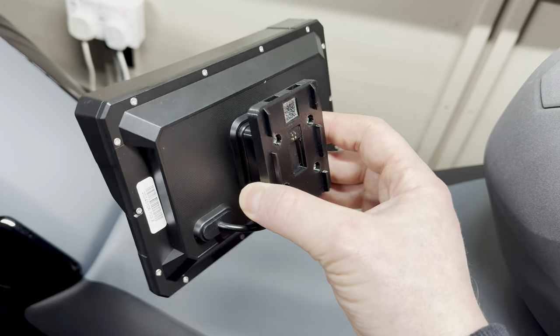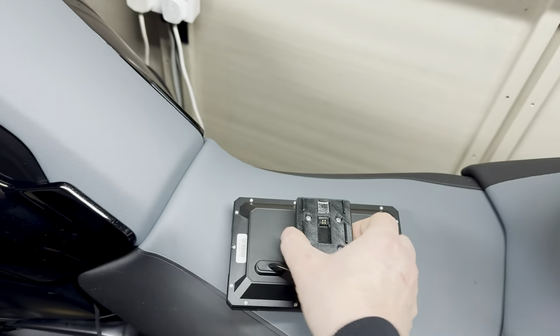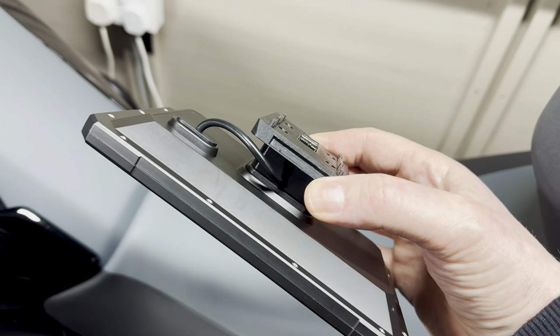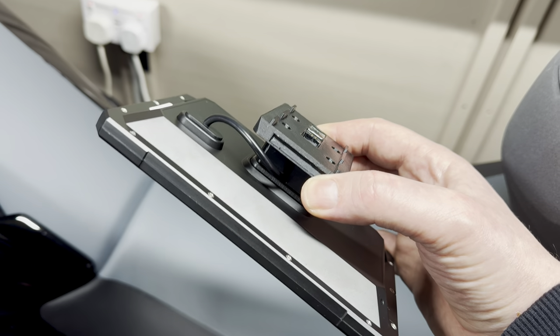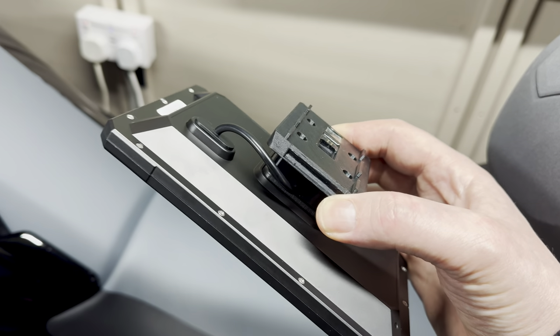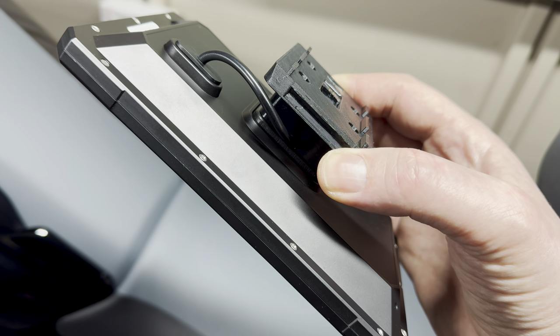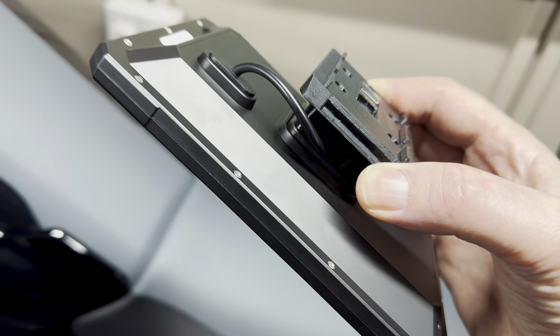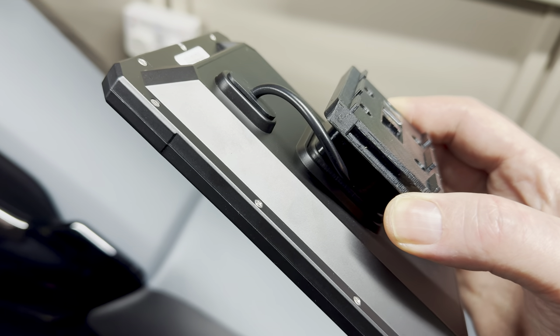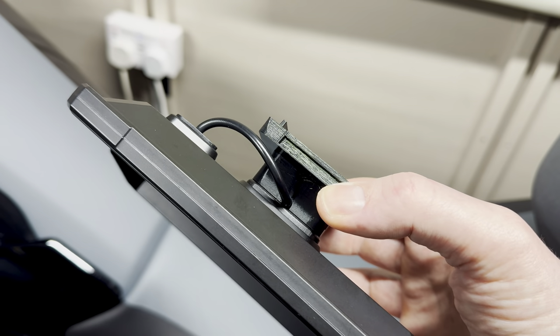He sent it out with full instructions and it arrived in just under a week from Spain to the UK. Very reasonably priced and as good quality as the 3D RAM mount I've got for my Garmin Zumo. As you can see, it basically bolts onto the back and picks up the power from the BMW cradle. There was a bit of wiring — I had to take the plunge and cut the wiring that came with the W702, which was a bit nerve-wracking, but it's only two wires. I could have run it straight to the battery, to a USB, or I've got the adapter to plug into the BMW CAN bus. But I took the plunge and it works brilliantly.